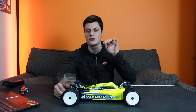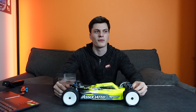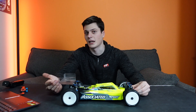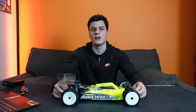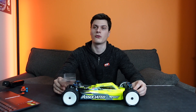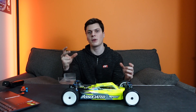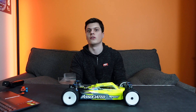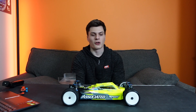And that allows you to just pivot quickly in the slow speed corners, sort of drive a little bit more from the rear end. Usually on two-wheel drive you probably won't have anti-roll bars on, but even thinking about suspension stiffness, that's kind of what you would do. I do know some people that on two-wheel drive in the wet — even though it's so low grip — will run a rear anti-roll bar just to get that big difference in stiffness between front and rear to really make sure the car turns. Sometimes it's worth sacrificing a bit of grip in order to get through the corner quicker and be out the other side faster.